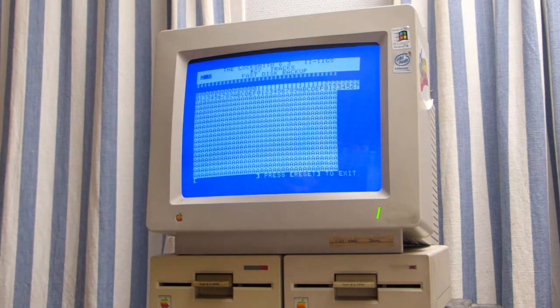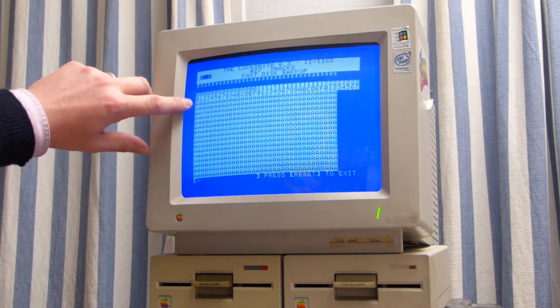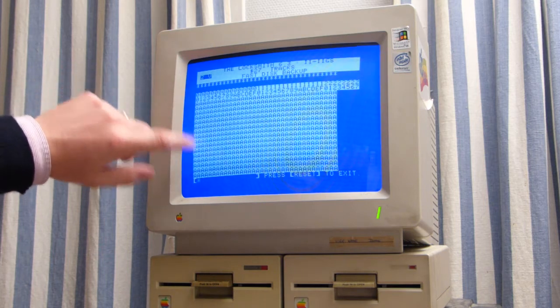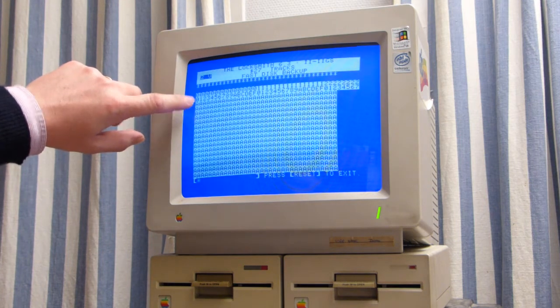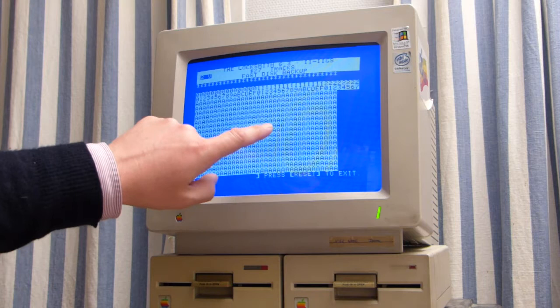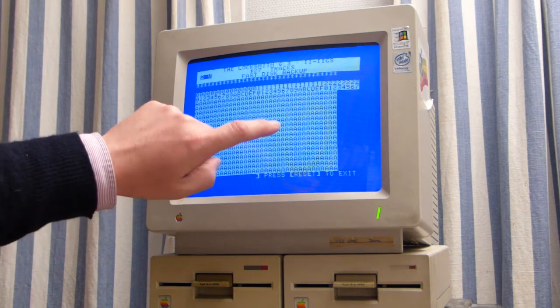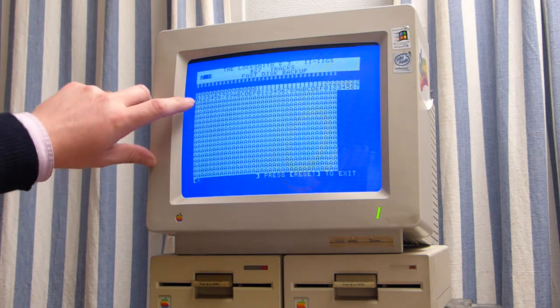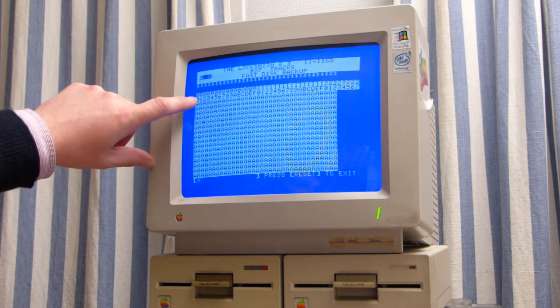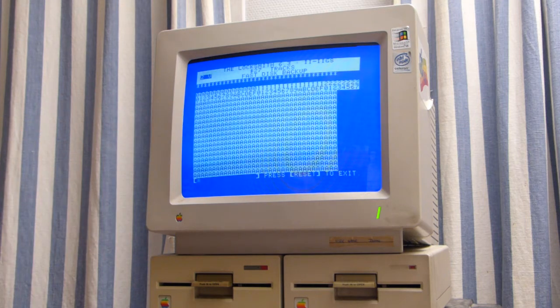So if we have an A here, that just means that the standard markers for the header field have been changed. What is to know also is that a diskette always boots on track 0, sector 0, and we have an A. If we have an A here, that means that the system is protected with the change of the final marker of the header field. Why? Because the values are not checked by the routine in ROM to boot the diskette, but the header field, the first marker D5AA96, is always checked. So this is interesting to note.